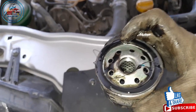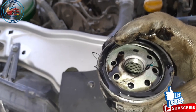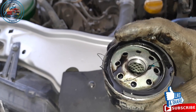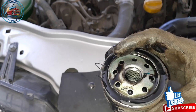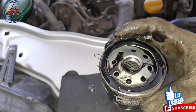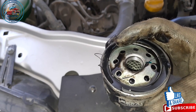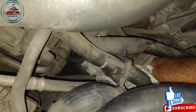While taking out the old oil filter, make sure the gasket comes out with the oil filter. There is a chance the gasket will remain on the engine area, and once you tighten the new oil filter there will be a double gasket and the oil will start leaking. So make sure once you take out the oil filter, this gasket is present on it.